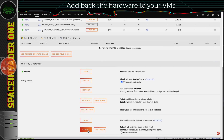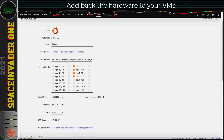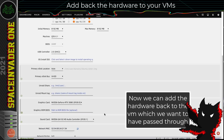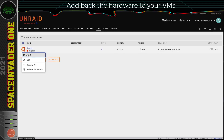Now we can reboot the server, and once it's booted up, we can go to the VMs tab. Here's the VM we had running on the old server — we'd set it to VNC graphics. Now we can click onto it and go to Edit. We can see the logical CPUs are slightly different — obviously there are a lot more cores on this server. So I'm going to give it four cores, eight threads, up the memory to eight gigs, and scroll down to add a graphics card back — the RTX 3080 — and add its sound counterpart. And because I've just stubbed this USB controller, I can add that as well. Click Update, and now this VM will start absolutely fine with the new hardware.